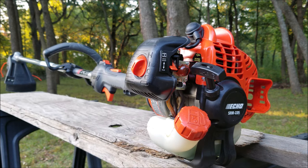More than likely, the trimmer was put up in a shed with a full tank of fuel during an extremely hot summer. If you have to put some equipment up for more than a month, I would consider at least emptying the fuel tank. If you have to leave fuel in the tank, try using pre-mixed fuel from a can, which will store much better.